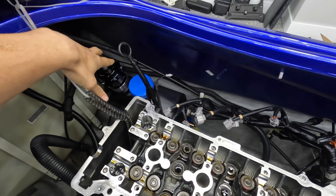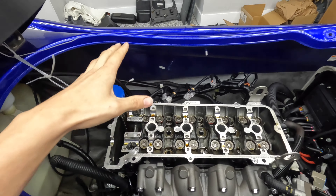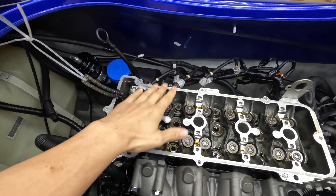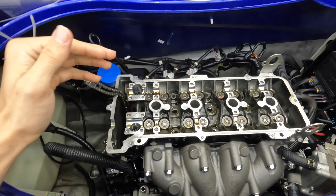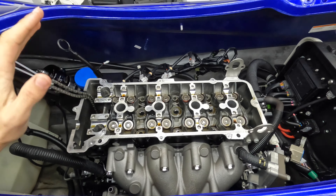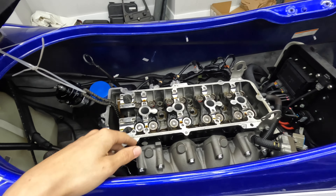I've already begun working on this ski. You can see I've got the Fizzle installed and most of the cooling kit in here, but I do need to do the retainer upgrade and the supercharger shaft kit upgrade that this customer opted for. I'm going to be showing you guys mainly in this video how I do this and a couple other things along the way.